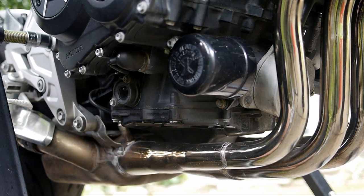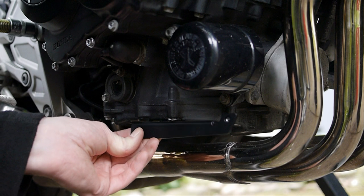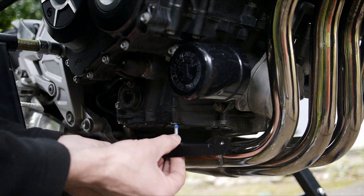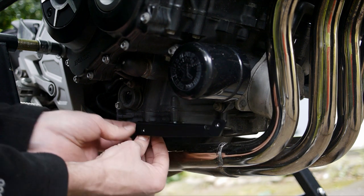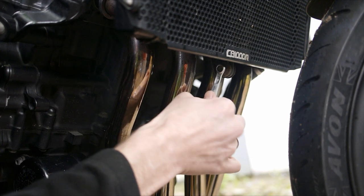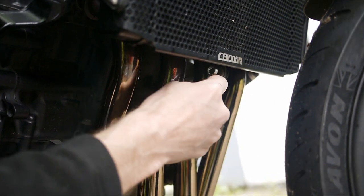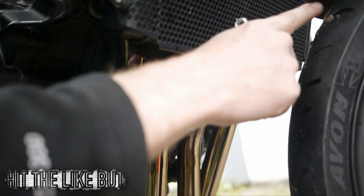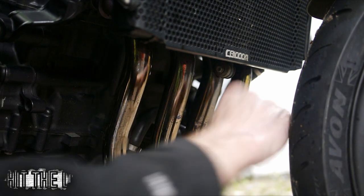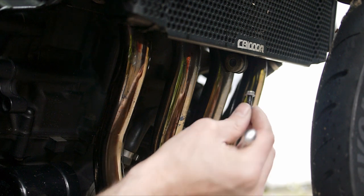Right, with those bolts off, this should be pretty easy from here on out. M6 Allen-headed bolt, dollop of threadlock, times two, washer on each. Bracket up to the holes on the engine. Thankfully that now covers over all the bits where I've scratched the paint off the side, but the sump was knackered anyway - watch my video about my sump and paint woes with Honda to find out more about that. Second bolt at the back - leave them loose to begin with so we've got a bit of play for mounting things up. And then it's up to the bottom radiator mount with my new Wera spanner. That is exceptionally rusty though - another thing that annoys me about motorbike manufacturers: they put the shortest mudguards in the world on, just to pre-ordain that your radiator, your exhaust pipe, the front of your engine are going to get absolutely pebble dashed.